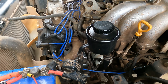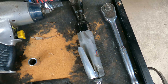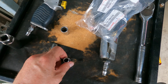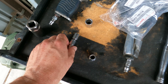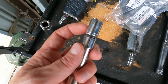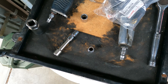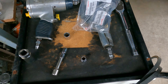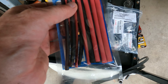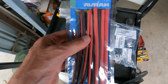Tools for today: two fusible links so I can keep one as a spare in the glovebox, a 3/8 air ratchet, a rattle gun to rip the tire off, a 14mm socket for the top bolt on the alternator, and either 10mm or 12mm for the adjustment and bottom bolts. I also bought a brand new socket the other day but I accidentally bought a quarter-inch drive instead of 3/8, so that's going back. For the plug soldering we'll heat shrink everything up nicely — this heat shrink is handy to keep in the car and you can even use a lighter in the bush to shrink it down.